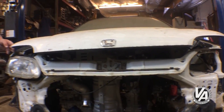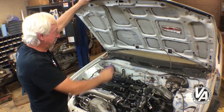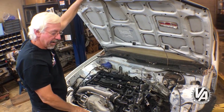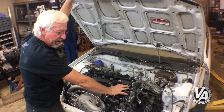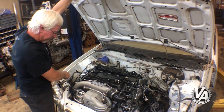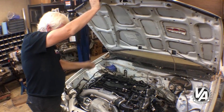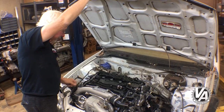With the engine set, we tried the hood. Ground clearance would be similar to a K24 in this car. The hood is sitting up about two and a half inches on the sides. We could gain about three-quarters to one inch back by removing the hood skeleton, and probably another inch and a half by moving the vacuum lines and intake air tube to the other side. But the wastegate is also in the way, and those vacuum lines would need to be moved as well.